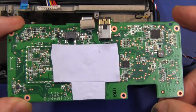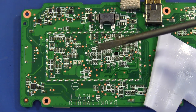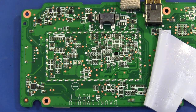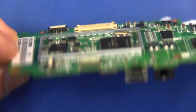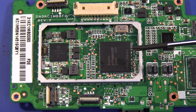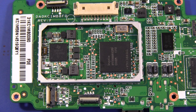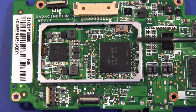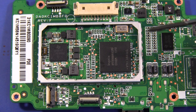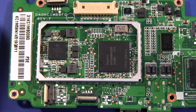They've really tried to nail this one. Underneath that silicon pad there's not really much of interest — just decoupling and a lot of unpopulated decoupling parts and other passive parts under the main processor and main SRAM. Now let's take a look at the main processor section. You might think this big device is the main processor just by its sheer size, but it ain't. Here's the processor over here — it's a TI OMAP processor running at one gigahertz. It's the 4430, I believe. The large device here is a Hynix brand — that's your RAM memory, 512 megabytes. And there's a crystal oscillator and some power supply stuff surrounding the processor.